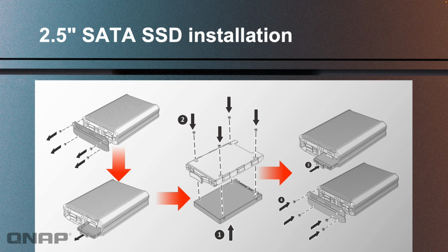It's still able to get some pretty high performance figures, even with encryption enabled. For anyone interested, this is how you'd screw the drives into the trays. They're not screwless chassis for the drives, so you do have to put 4 screws per SSD. It's mainly for anti-vibration. They've got to be held in place physically, so we use these little screws that we supply in the box to attach the drives to the metal drive trays. We've used metal trays just to transfer heat through to the chassis much more effectively than with plastic trays, for example. There you can see the 4 thumb screws that you would use to attach the front plate to the NAS.